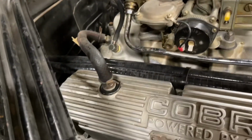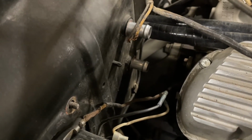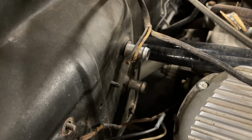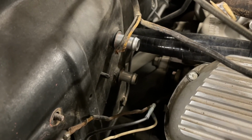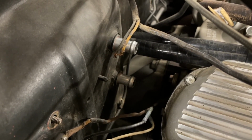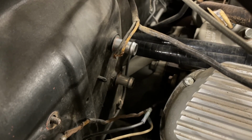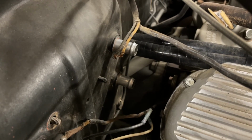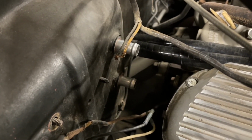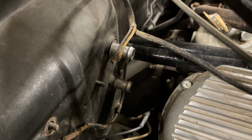Now, when we connect these, the shorter hose, or the hose from the intake manifold, needs to go to the bottom port on the heater core. The upper hose goes to the water pump because that feeds to the inlet side of the water pump. That means if there's any air trapped in the heater core, the water pump is going to pull that air out of the heater core assembly so that all you have in there is coolant. And that would be the reason for routing the hoses the way they're routed from the factory, is basically to make sure that the water pump is doing its best job to pull any air out of the heater core assembly, and it should work really well that way.